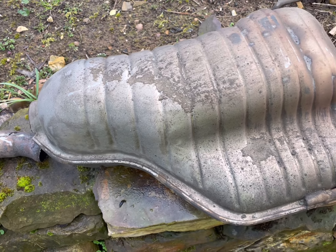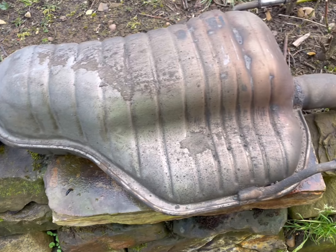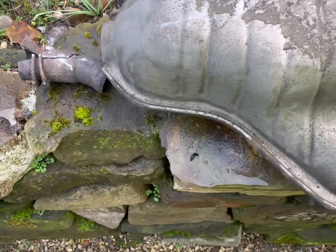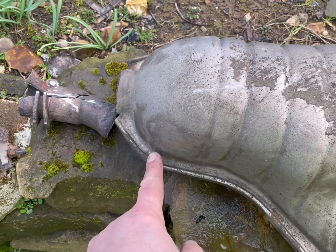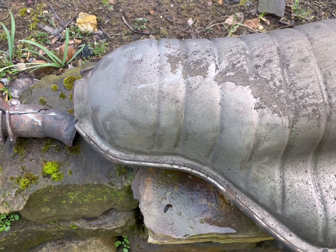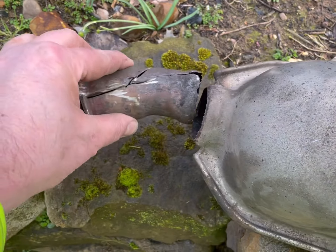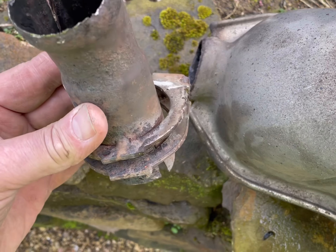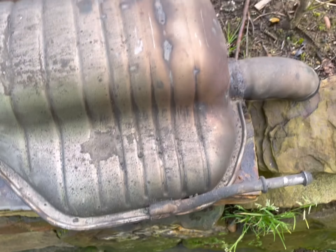Just to finish off, this is the culprit. Not a fan of these Vauxhall exhausts — they really are heavy. So if something breaks, the whole thing's going to come down. Could really do with a hanger there — if there's a hanger there it's not going to cause problems, because if this falls off on the road while you're driving it's going to cause a lot of problems for the driver behind you. So all you've got is that bit there, and once that rusts, that's your problem — it just breaks off. You could weld it, but I've seen it welded and they don't last very long.